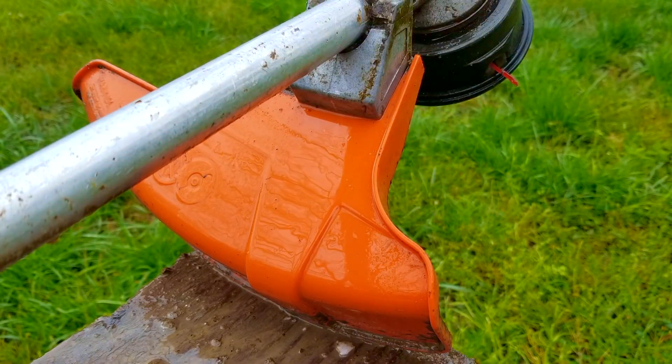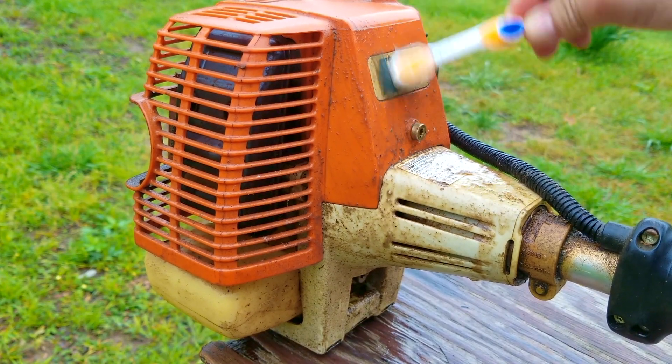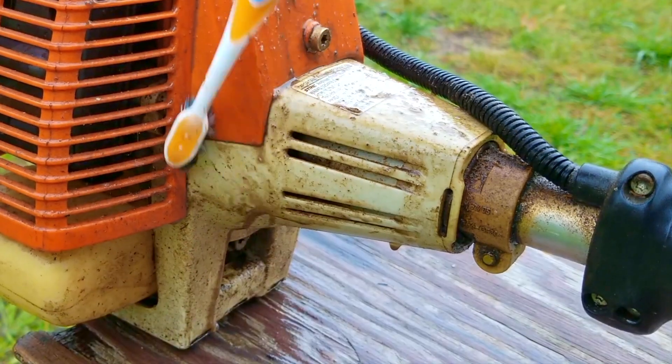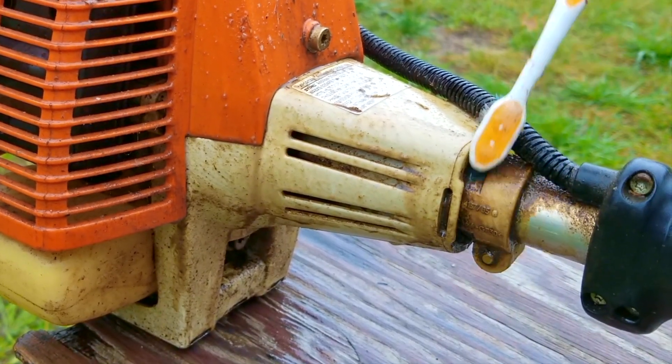The cleaner I'm using is an orange-based cleaner, but most anything will work as long as it can cut through dirt and some oil. When it comes to sticky old gasoline, you can also use stale gas or brake cleaner. I'm also trying not to use water to wash away the dirt, but as long as you're careful it's not a problem — just keep it away from the muffler and the air filter.